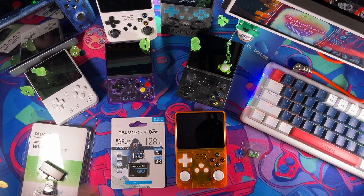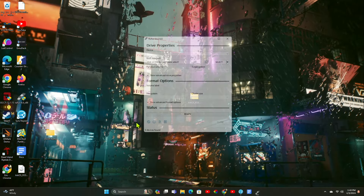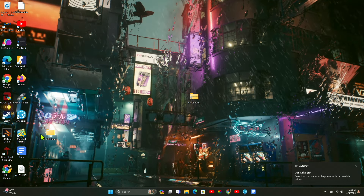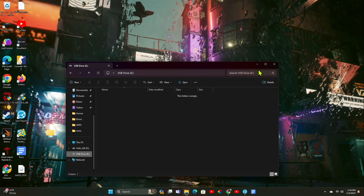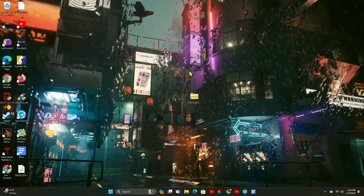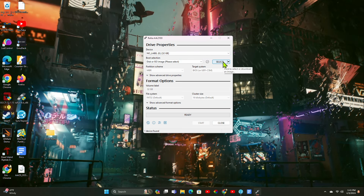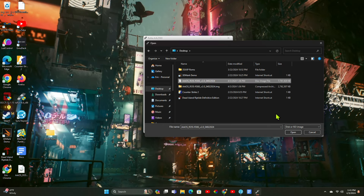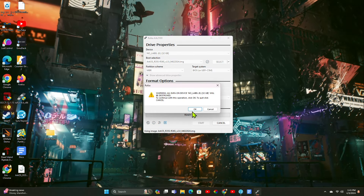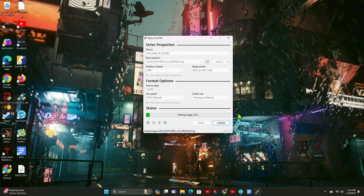Now we should have this image file on our desktop. We're going to go into our Rufus tool — if you don't have Rufus, link is in the description. Rufus is a good way to write things to a card. We're going to choose our drive letter. We need to put the card in first — close Rufus, put our card into our card reader. If you don't have a card reader there are plenty out there. Now reopen Rufus, select the eDrive — make sure it's the right drive because you could rewrite your hard drive if you chose the wrong one. This is only giving us external as an option, which is one nice thing about some computers. We're going to select that folder on our desktop — it's the ArkOS R35S and R36S version 2 image. We're going to hit start and this will take just a few minutes. Because it is a new card it won't take real long since the first part is deleting partitions. We'll let this run here for a minute and then come back to it.